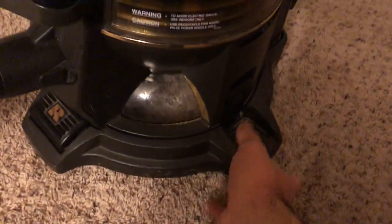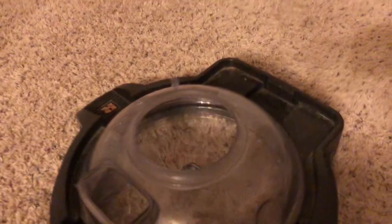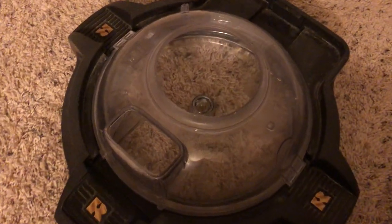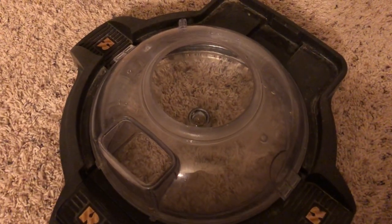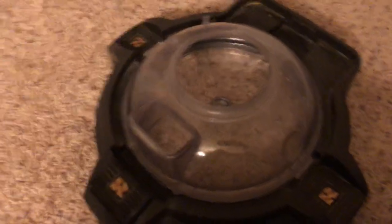And also to get access to the water basin, you just release the latches on each side. But you have to again press down on the pedal release to pull the motor unit off. Only this time, you won't pull off the water basin with it. This right here is its 2-quart basin that's used for all the E-Series designs. These will even work on the later E2 2-speeds, including the gold, blue, and black model.